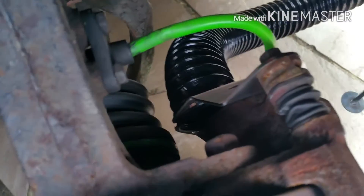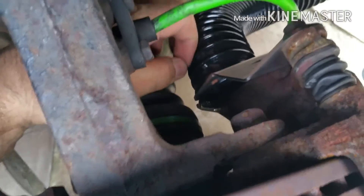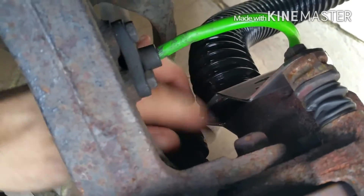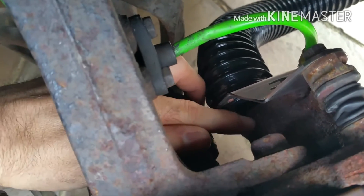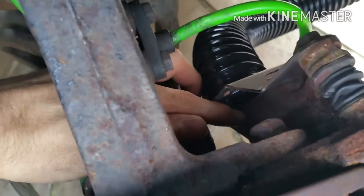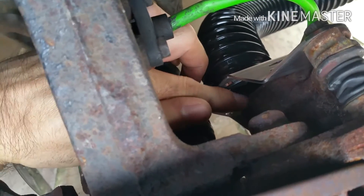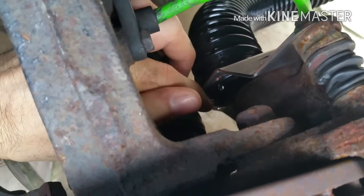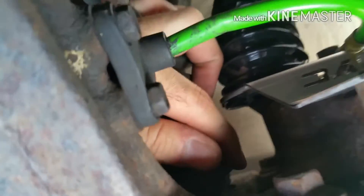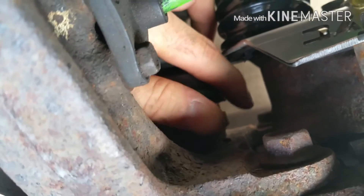Within the Alva I've actually advertised it as a 60-40 split cooling system. The way that works is: 60% of the air coming around here will smack and hit the back of the actual pot where your fluid is — your piston pot — which will be air cooled. Then the air will bounce back off the pot and join the remaining 40% of air that's rushing straight forward to the back of the actual caliper.